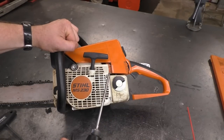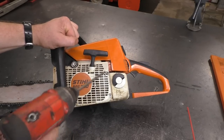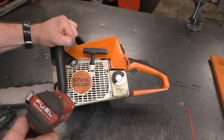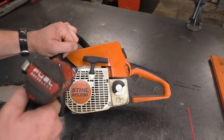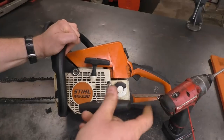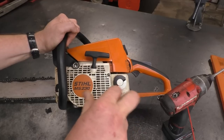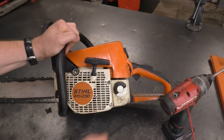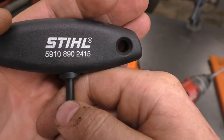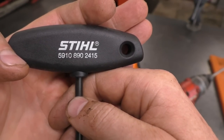With the impact, tighten up the screws on a really low torque and then finish them off by hand. When you do this, you want to do it in a diagonal pattern. Grab your T27 screwdriver and finish them off by hand. Put these screws fairly tight — I don't have the specs but don't overdo it, because all these screws are going into plastic. If you're wondering what screwdriver I'm using — it's from Stihl. The part number is in the video description. Now the recoil is grabbing correctly.